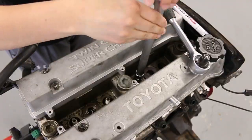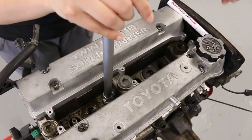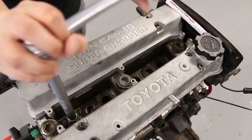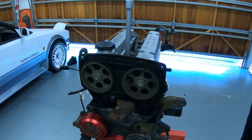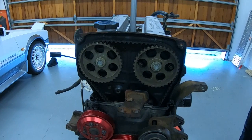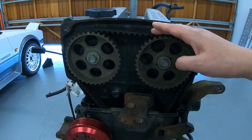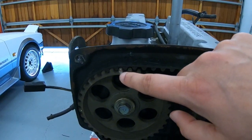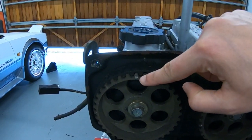So I'm going to remove the spark plugs. Today's goal is to replace the head gasket, along with cleaning and replacing every other seal from the head up. All four spark plugs will need to be removed. The little notches on the cam gears are indicators for top dead centre — you definitely want to line these up to avoid damaging your motor. Thankfully, the 4A platform is a non-interference engine, so I wasn't nervous about messing that up.